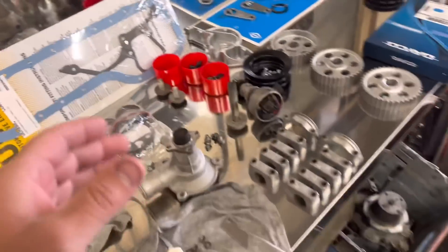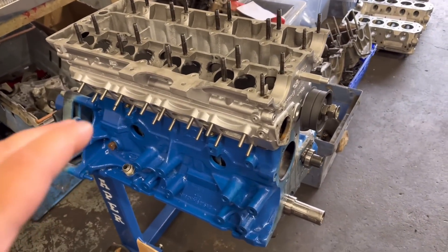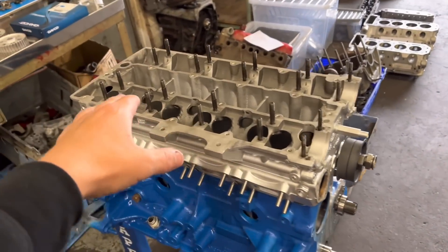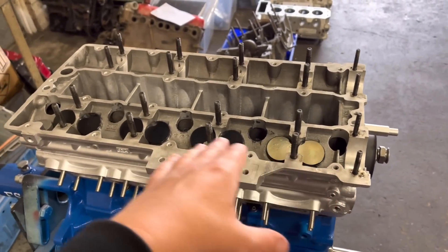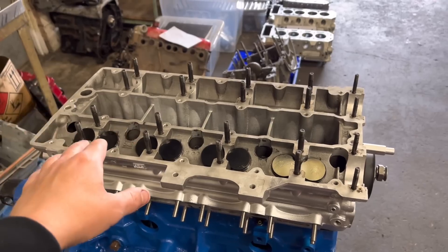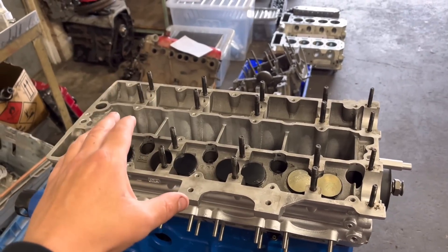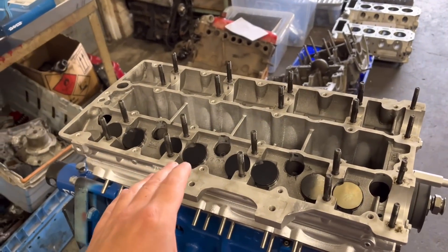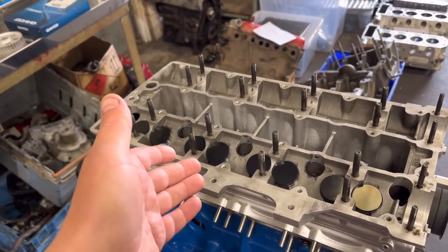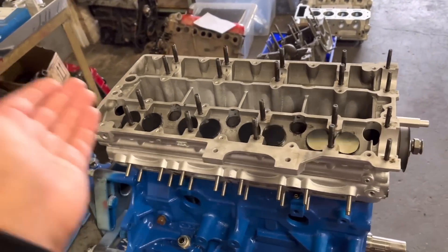It's lovely to work clean and not have any dirty horrible bits. What I'm going to show you first of all today is I'm just putting the exhaust studs in, as you can see. I've got to paint the exhaust manifold. But you see here, I've got a row of hydraulic lifters in there. Now these are the original hydraulic lifters - they're the twin chamber ones. A lot of people on the Cosworth will sell or use the Volkswagen PD lifters. They're pretty much the same size but they are a single chamber, so you see them for sale for sort of £80 a set, which seems quite cheap.